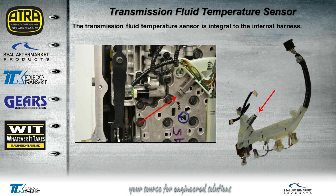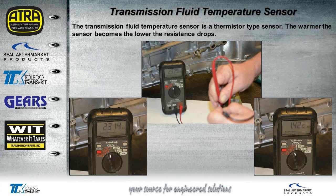There's your fluid temp sensor. It is part of the main harness. As you can see, there are just two wires coming in, so if we had another harness or another sensor, we could actually wire in our own. It's a thermistor type sensor — nothing unusual about it. Works like the ones we've always seen in the past. We added some heat to it, and as you can see, the more heat we added, the more the resistance actually dropped.